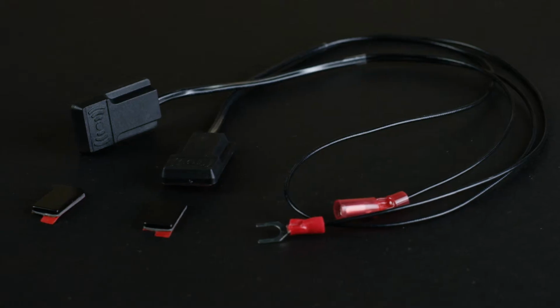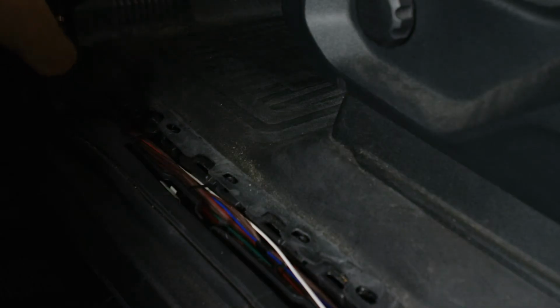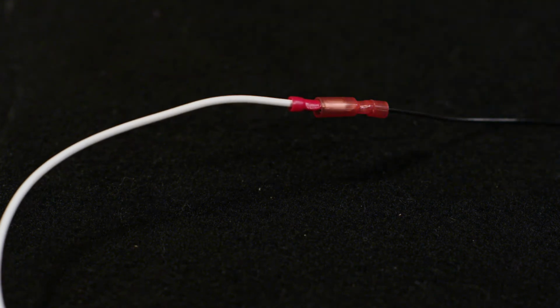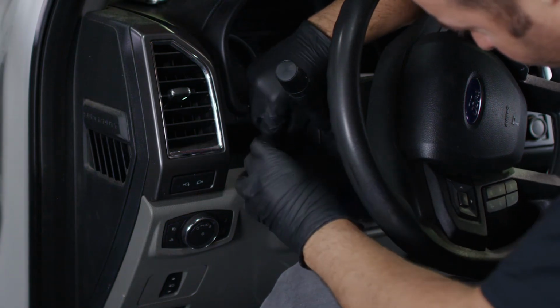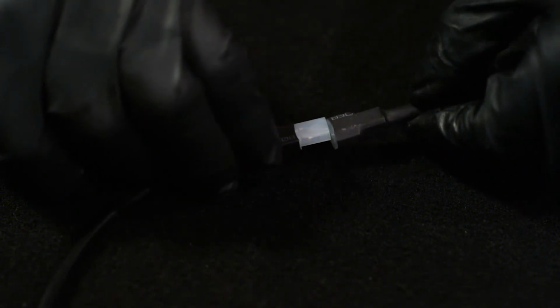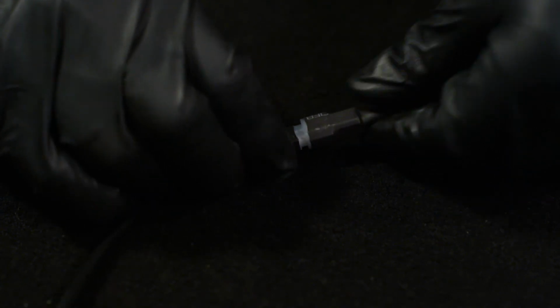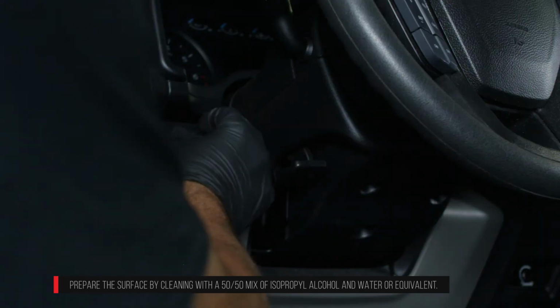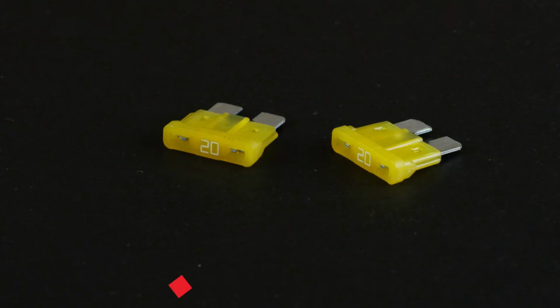Connect the driver's side door trigger harness to the white wire that was routed under the carpet to the driver's side B-pillar in an earlier step. Feed the disable switch wire harness below the lower dash knee panel and connect it to the black disable switch wires from the controller. Stick the disable switch next to the steering column on the lower dash knee panel.